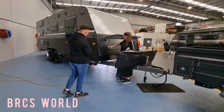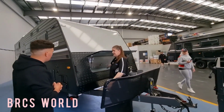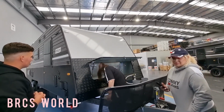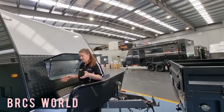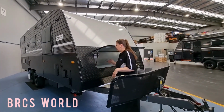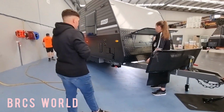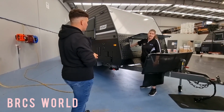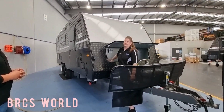So you've got your jack there, your fin plates and all your awning poles. This is for your legs, to wind them up and down. And for your ties, there. It is a gal box and they do get a fair bit of condensation in them, so I wouldn't put anything in there that I wanted to be 100% waterproof. If you want more waterproof, go into your tunnel boot, not your front boot. They do get a little bit of water in them, and they have a drain pipe on each side just in case. That's an 18 mil thick wall, so you can screw into it if you want to put stuff on it, like your hoses and all of that. That's 18 mil thick. Okay.